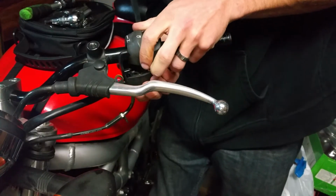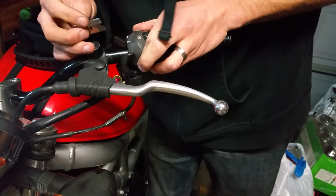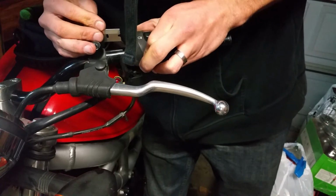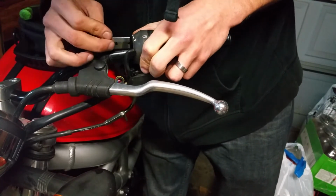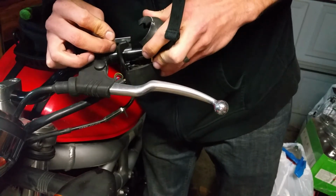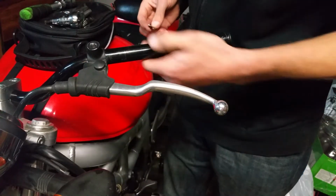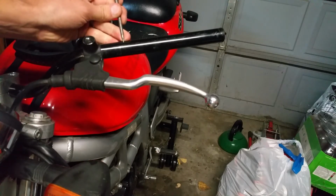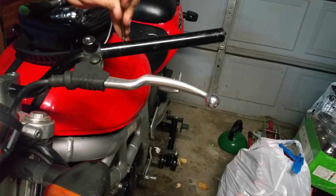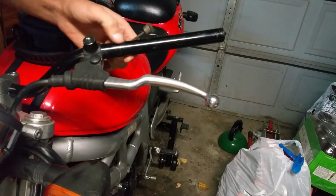So that looks good. Now, in the top part is the pin that actually goes in the hole. You'll find it and then score along that line in the other direction. So we'll be right here. Now we got our center spot to drill the hole. So we'll find ourselves a nice hole punch. Get right in the center of the two marks, and create a nice little hole.